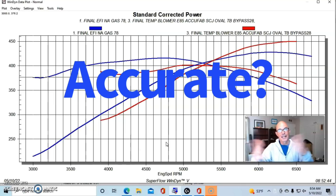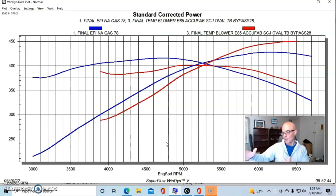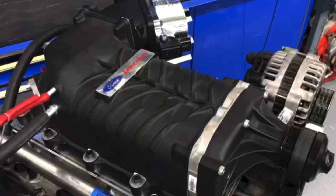Let me know what you guys think — do you think that's fairly accurate? Obviously the best way to do it is put the blower on an actual blower dyno where you're spinning it at this blower speed, flowing this much air to support this much power at this boost level. That'll actually tell us exactly how much power is required to drive that blower. And guys would actually be surprised how much it takes. I remember having conversations with people telling me it only requires about 40 or 50 horsepower to spin this blower — well, it does if you're only spinning it to make five pounds of boost. But when you're spinning it to make 15 or 20 pounds of boost and seven, eight, or 900 horsepower, the parasitic loss associated with driving these blowers goes up dramatically — it looks like a linear curve, then at the end it really comes up on the cam.